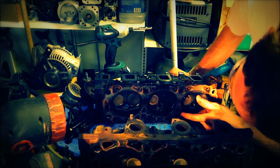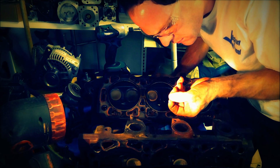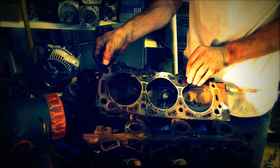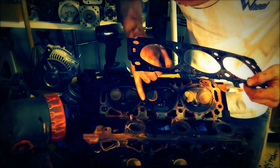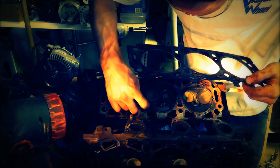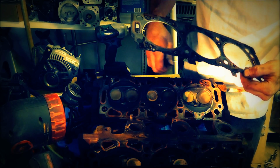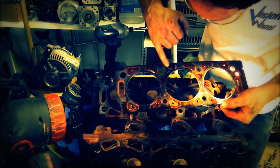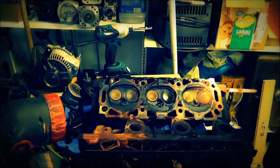This side of it looks pretty good. There is, looks just like oil. Not too much else in there. Yep, look at that. Well, it may have just broke, but it looks like these two cylinders could have been leaking. And these two cylinders, well, there's still a little on here. Maybe not. Hard to tell because some of it broke off. May have had a little leak. But definitely, definitely, this other head gasket was busted. So, it's a cool deal.